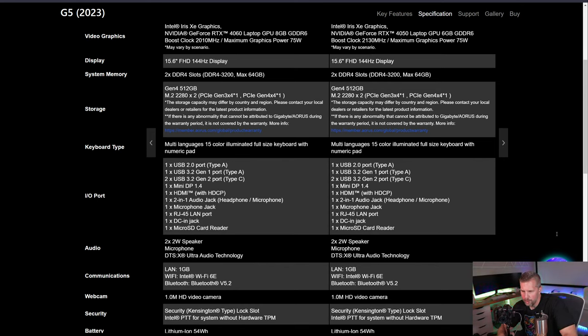All right, so we're popping into NVIDIA control panel here, and we're gonna go to configure surround, PhysX. So the laptop display is connected to the Intel GPU. That's going to show us that we're not using a MUX right now. It looks like the mini DisplayPort on the back is connected to the NVIDIA GPU. There is an HDMI on this, and there are also two USB-Cs. I don't know if the USB-Cs have DisplayPort 1.4, but they are USB 3.2s,